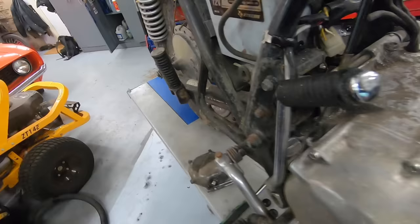Now that the engine has oil in it, I'm gonna go ahead and spin it around with my drill and we can see if this thing works. I went ahead and threw the stator on the other side to make sure that little plug doesn't push out. It's actually the same oil galley that meets up on this side, on that side, and I just had forgotten that the stator needs to be in place. Otherwise, that thing pops out and shoots oil all over the floor. So I'm going to turn the engine over from this side.